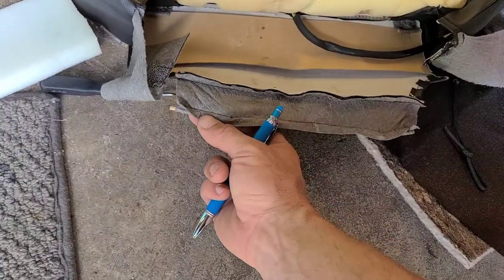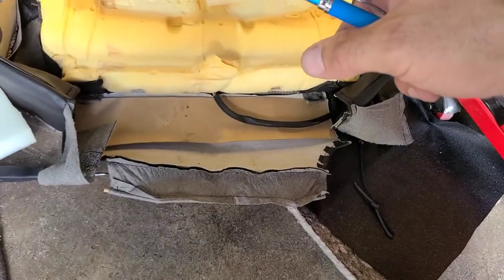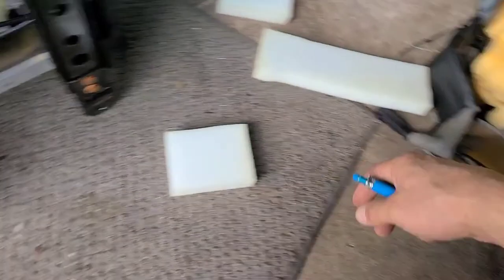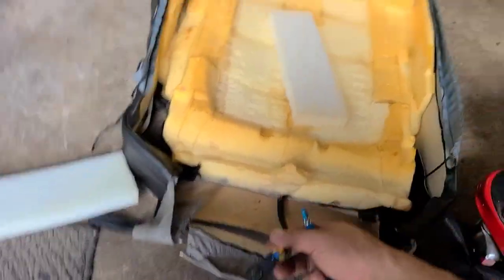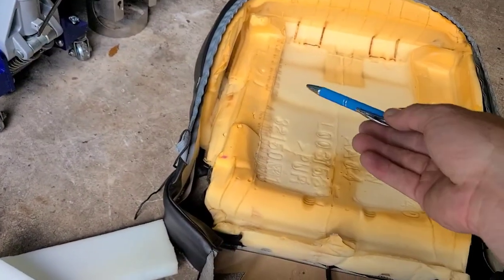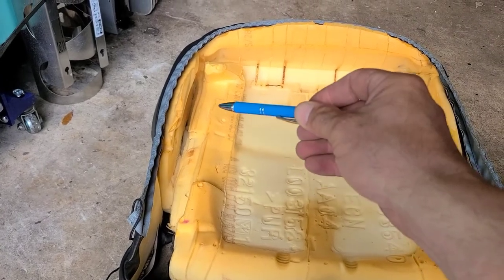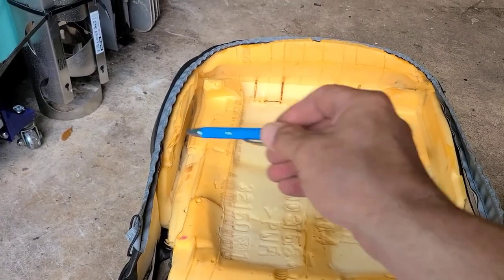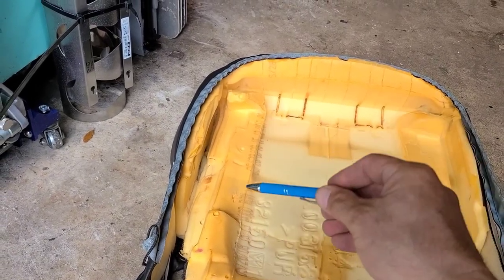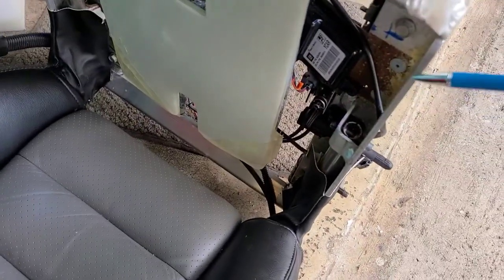I guess I'll just do that — should be good enough. So this is the foam taken off. I had to unclip the seat heater plug. And then these are the strips of foam they include in the kit. I'm going to try using Super 77, which is what they recommended for foam, to try to rebuild that bolster. That's basically where the passenger would slide in and out — probably a sizeable previous owner — because that destroyed it. So basically the metal frame of the seat itself ends up cutting into that.